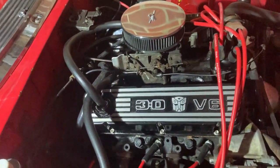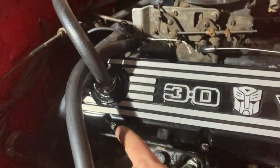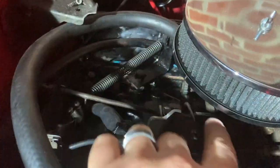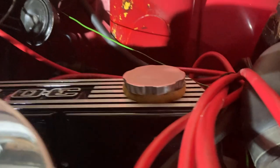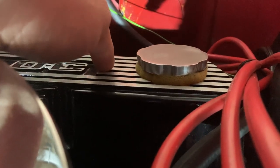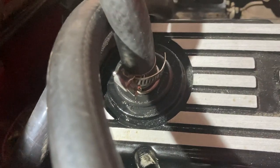So this is what's going on - got some new rocker covers, very nice, but they don't have a splash shield for the PCV takeoff, which should be just air going down a hose and back in underneath the air box. It also doesn't have a spout for the oil filler cap, it just goes straight in flush. What's happening is oil is going through the breather holes and spraying out. A bit of foam sort of does the job to stop that, but I've split the plastic grommet so there's oil leaking out of there anyway.